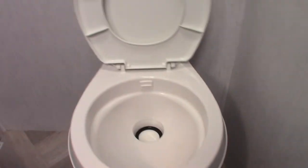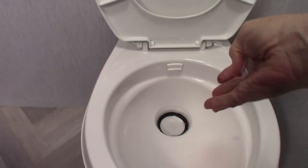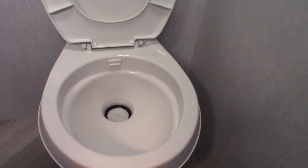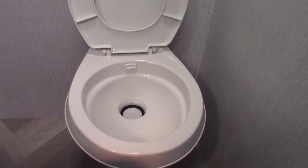The sink and shower work like any other sink and shower. The toilet is an RV toilet — this is the flush pedal. You can't use it dry, meaning the black tank directly below. When you get to the campground, hook up your power and water, come in here, put a dose of chemical in the bowl, then step on the pedal and hold it down so you put at least a gallon of water in the tank. Then it's all ready to use. You can't use it dry because the smell will be extreme and it can get clogged, so you always have to have chemical and water in it. You have a fan here as well.